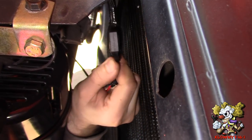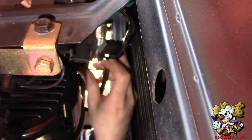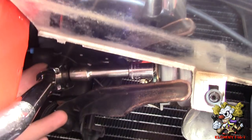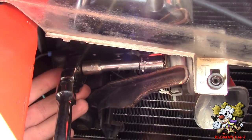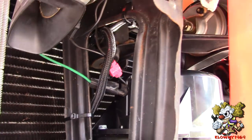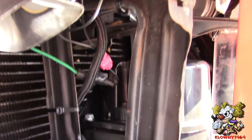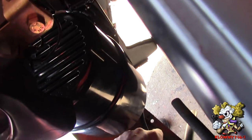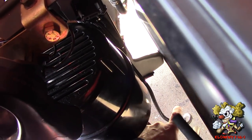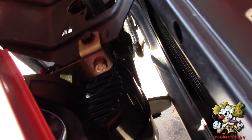We're going to wrap this on top to keep the fuse accessible from the top and route the ground wire over to the horn. We've routed the ground right where the horn is — tighten that down and we're good. From here it's a nice clean install. On top you don't even see any wires — this is going to get zip-tied to the vacuum hose underneath.